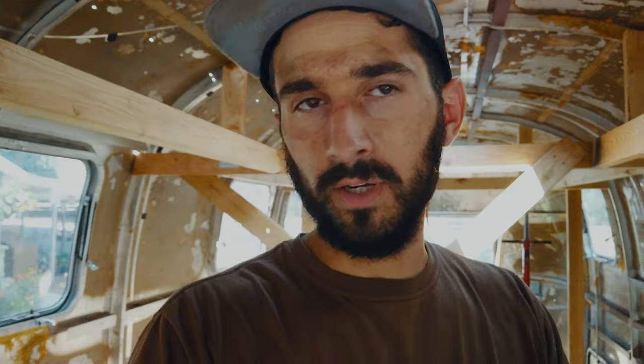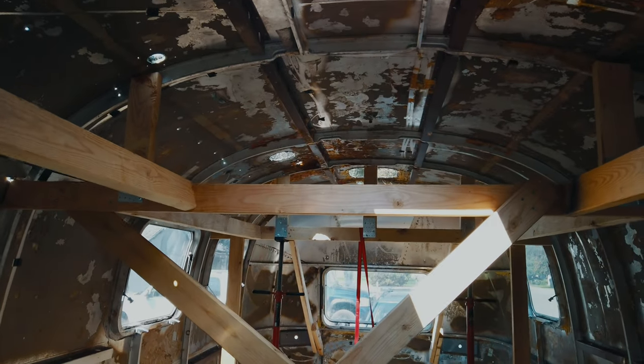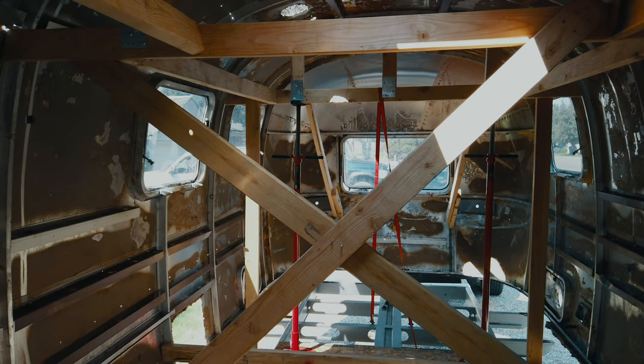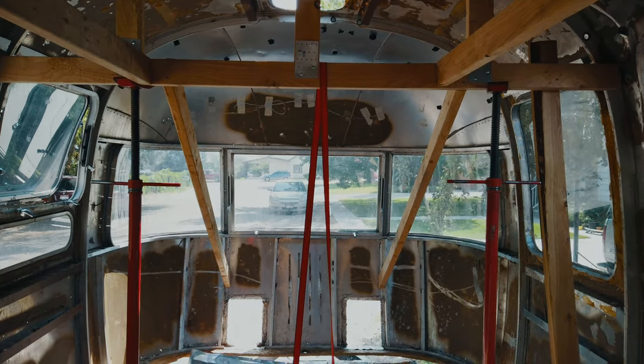That's one way to lift an Airstream shell. I'll let you know in the next video if it stays up and doesn't fall over — I'm not too worried, I think we're good. I ended up adding three more two-by-fours going straight down to the ground on the front and back. I'll probably add another point of contact since I ran out of screws. We've got our A-frame connected to the center truss going out through the wheel wells into the ground, and I lowered the pole jacks just a little bit so there's actually weight on those legs so they're in the ground and not just floating. It's getting pretty crazy in here — definitely hard to maneuver.